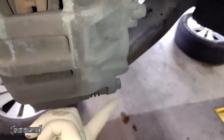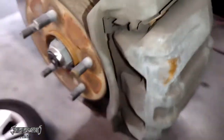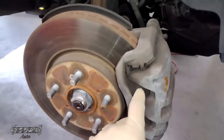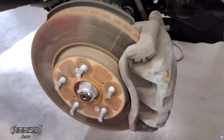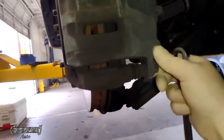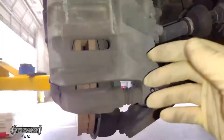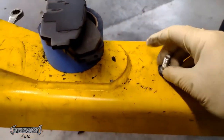What I do is come in and get this 14 millimeter off on the bottom, and I'm going to get these pads out. Now I'm going to do the rotors too — I was going to resurface them only, but they're too close to the discard, so I'm going to get new ones. Get this 14 millimeter bolt off. That nut on the other side might spin; if it does, just hold it with some pliers or a wrench. We'll put that to the side.